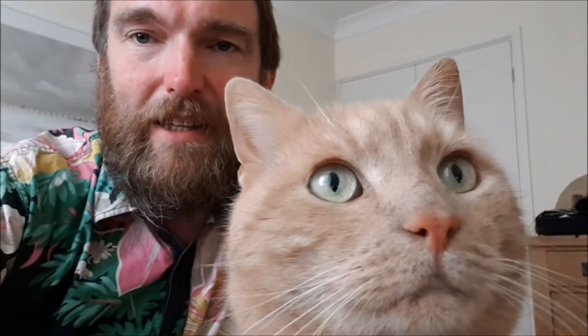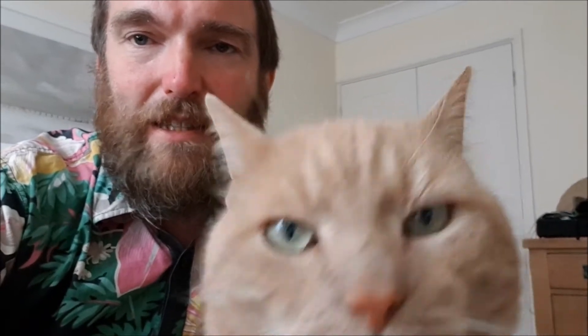Well hello again. Today I had a bit of a problem with the electric bike. The highest gear on the back sprocket is slipping. I've had this problem before — it's the smallest cog on the sprocket that just slips off the ends. The little nut thing that holds it on just works loose. I did thread lock it on before and it lasted for quite some time, but it's fallen off again now, so let's see if we can fix that so I can use it again tomorrow.